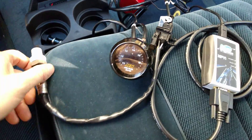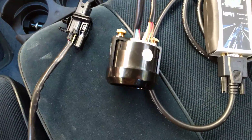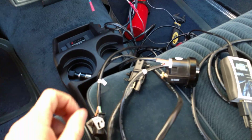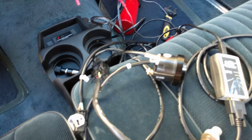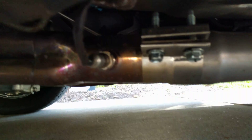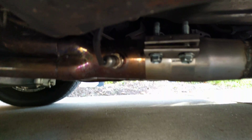I haven't even welded in a bung yet on the exhaust. When I'm tuning, I just unscrewed the narrow band right here, let it droop, plugged the wideband in right there, screwed it in, and just ran the wire up the door. That's how you physically install the input for the HP Tuners wideband — not hard to do, very easy, and it works great.